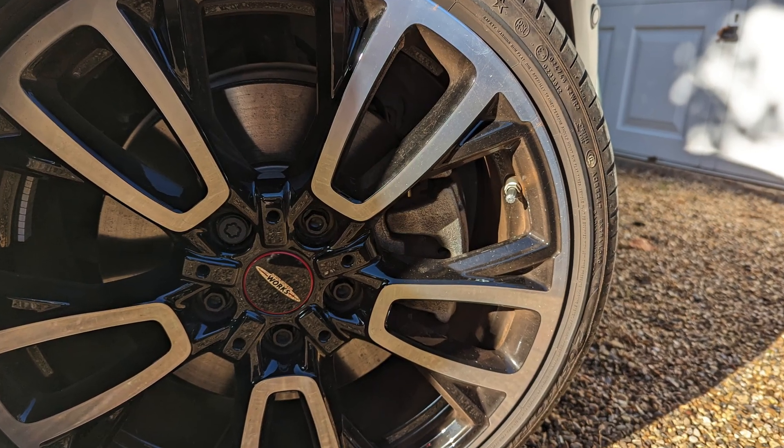You can see I've been taping out the car, and now we're doing a bit of an inspection. Vinyl's got some swirls on — hazing, but not too much. Let's bring you in with the inspection lights and see what that was. A bit of hazing, nothing too bad though. These vinyls are going to need a bit. The bonnet wasn't too bad, and neither is the door, but this is probably the best example of the sort of marring we've got — the sort of love marks you get from general washing. So I'm going to give it a go with S20 Black on the Rupes yellow foam pad and the force rotation polisher from In2Detailing. First, I'm going to do a test spot and we'll see how we get on.